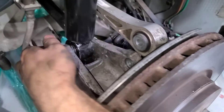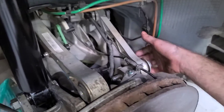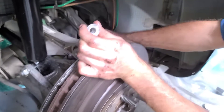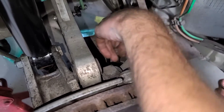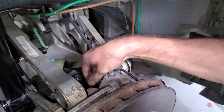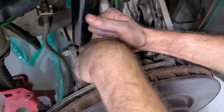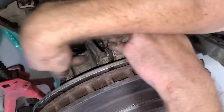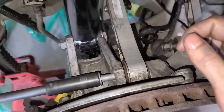What you'll want to do is have a friend push in on this rotor as you pull down on this front link right here and slide the bolt in. Once you have it aligned and slid in, go ahead and take this nut and put it on. Then take this control arm, push it into position, align it, and slide the bolt in from this side. Now we'll snug these bolts up.